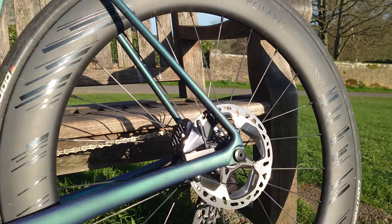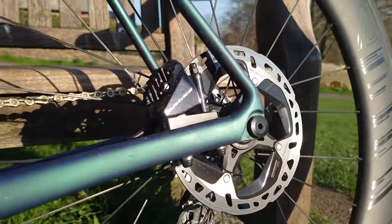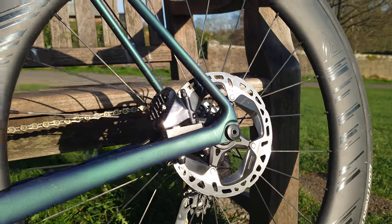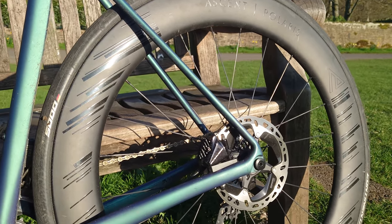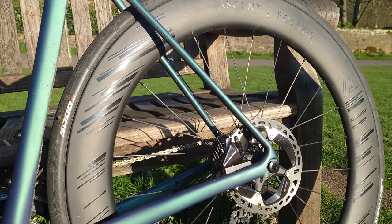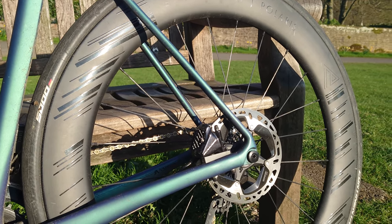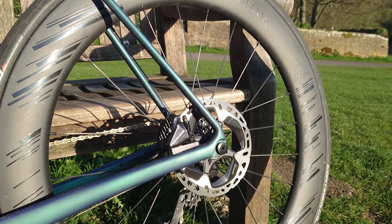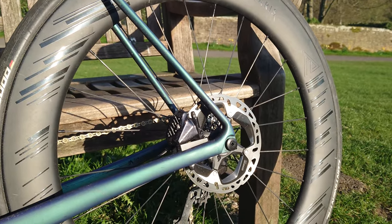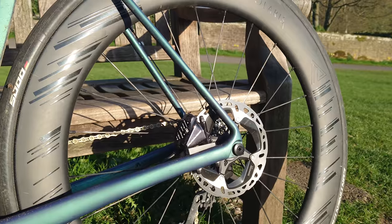It's not inconceivable to put a steady state one kilowatt input into a disc brake. On something that light that weighs 100 grams, that's a huge amount of heat and these things can't really take it. That's my belief anyway. You might not be able to picture that, but picture this: an 85kg rider going down an 8% slope at a constant speed of 30km/h is 600 watts of braking. So that's a lot of heat going into such a small piece of metal — that's a steady state braking input.